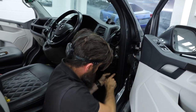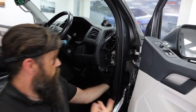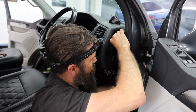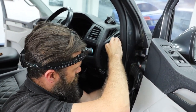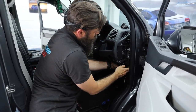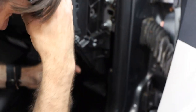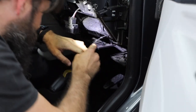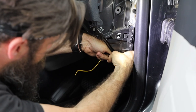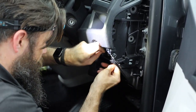Changing the direction of my hand — going up this way works a lot better. If you've fitted footwells and watched our footwell video, take off that under-panel, then drop the cable down and grab it through there. There we go — ultimate fishing champion! Feed it up as neatly as you can, routing past the various little looms and relays around the back of the dash. Now there's plenty of length to work with.